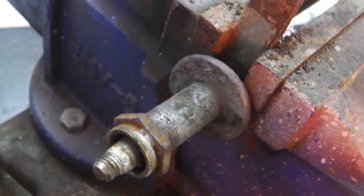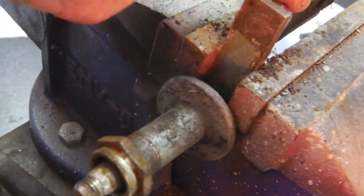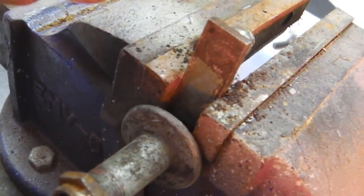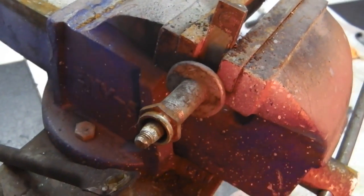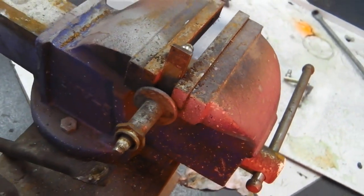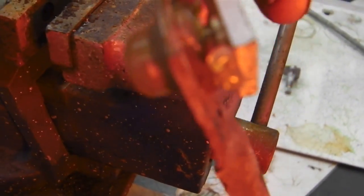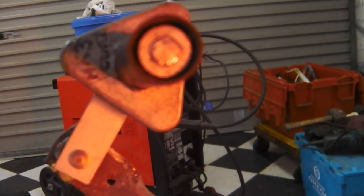spindle in the vise. Now I'm going to put in the pre-facelift one and pop the linkage arm back together after packing some grease onto it. I think I'll use some Lithium grease for that. Okay, here we go. Bad to the bone. Okay, packed in with grease and clipped back in. Went in with a nice satisfying pop. So there's beginning to fix up this linkage arm now and convert it to pre-facelift.